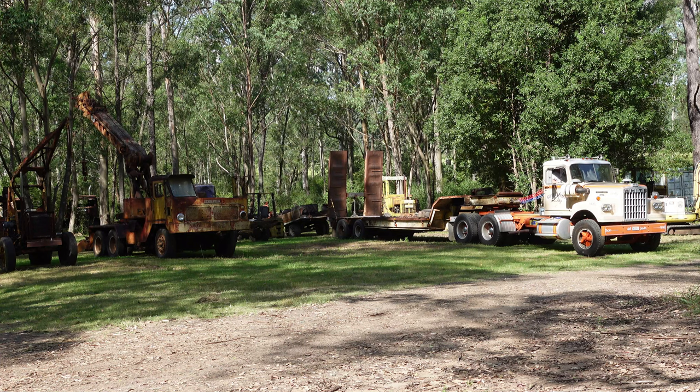These old Whites have only got a single air system, so your maxi for your truck releases your trailer too. Where a Kenworth, you've got a release valve for your trailer.